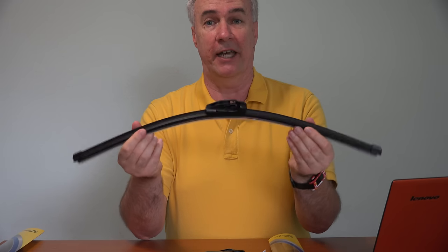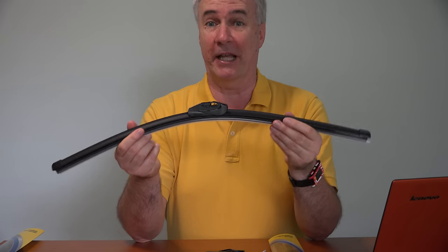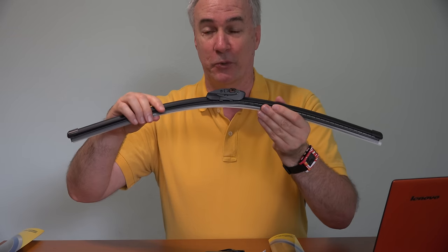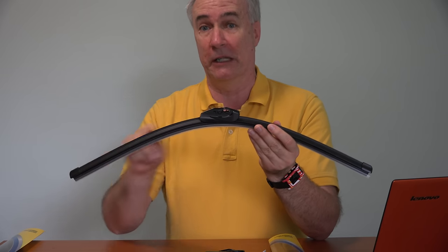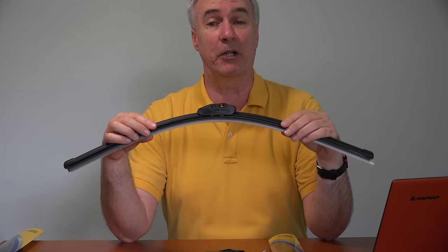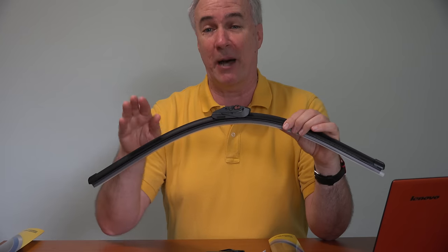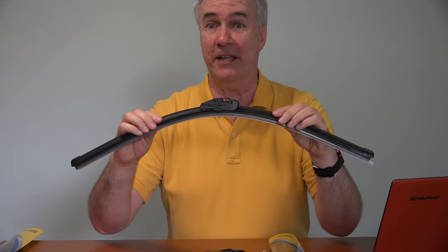Here's a beam style blade — you'll notice it's rather floppy and bendy. The traditional type of wiper blades don't do this; they have a metal frame on the outside and a rubber inset, and that metal frame is what pushes the blade against the window. The beam blade uses an internal metal spring frame. The reason it's flexible is that windshields now are so curved that the traditional type of wiper blade supposedly doesn't do as good a job of holding firm against it and wiping the water away. That's why these are more expensive and supposed to be better.